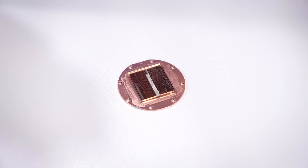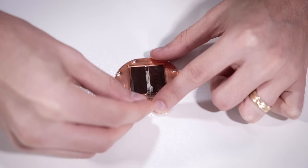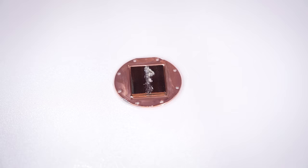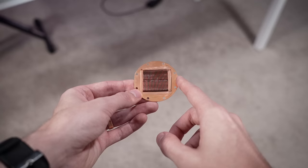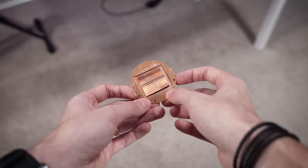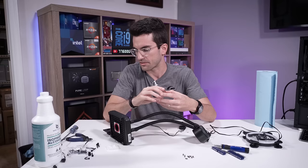No flow is no bueno, so we're going to douse this in some IPA. I'm going to take my SIM tray removal tool and we're going to scrape this gunk up. You guys have seen some of the dirty PCs I've cleaned — this is grossing me out way more. After scrubbing under hot water for a good while, you can see the result: it is a lot cleaner. There's no more clogging, and there are a few scratches just because the copper oxidizes. To answer the question for those wondering if this is repairable — the answer is yes. So long as your pump wasn't undergoing crazy amounts of stress due to the clogging, you should be able to refill this with either some kind of glycol solution or distilled water, add some biocide, add some corrosion inhibitors, and you should be good to go.